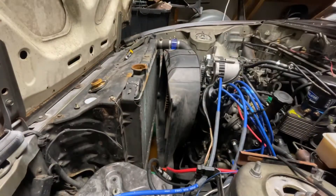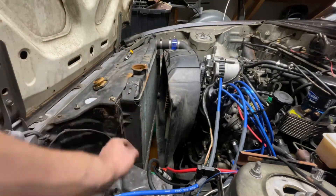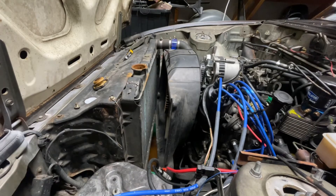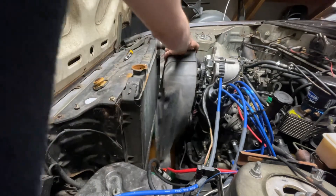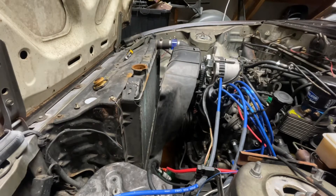All right, so this is after the trip to the junkyard to get the roll cage. Starting to do the work on the motor — water pump, hoses, radiator, and all of that. I'll show you what's going on. I drained all the coolant a couple of days ago. This radiator is pretty much all rust at this point, it's pretty messed up. Got to disconnect the upper hose — the lower hose is already done — the shroud is loose and set aside. I have to undo the metal bolts on that side and then I'm just going to cut that hose.